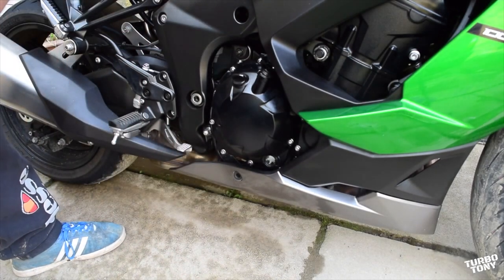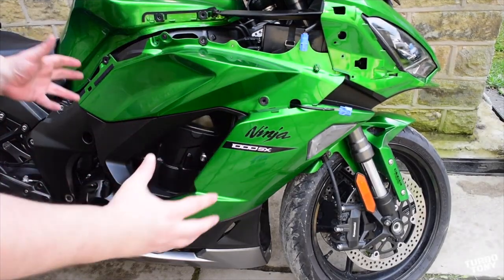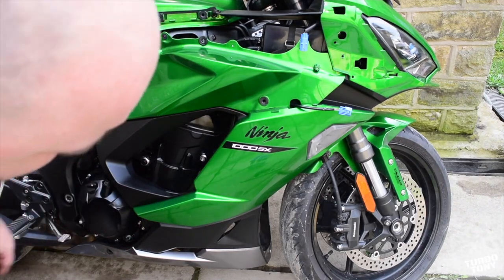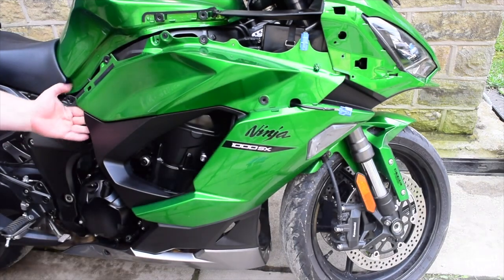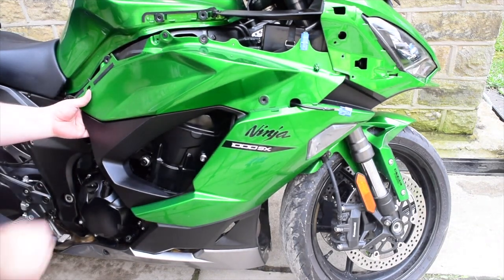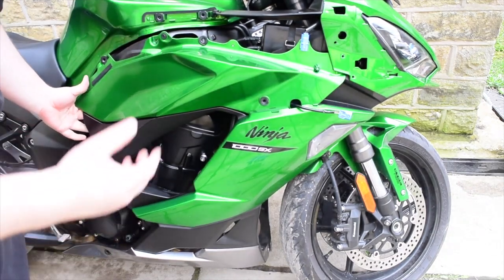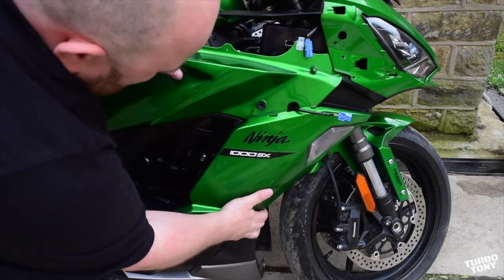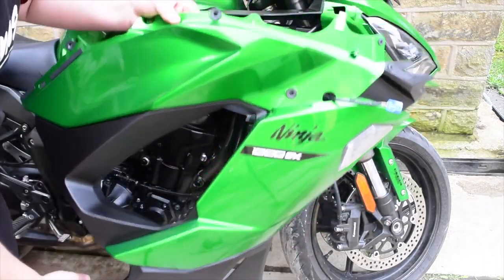The uninstall and install on both sides is exactly the same. Right, we're taking the main fairing off the bike now. We've undone all the bits — this should just slide out. Stick your hands just behind this bit here, there are some rubber grommets that should just pull out, and there's a hook there too — just pull it off like that, not too much force. And this front bit should just slide backwards — yes, that's all the plastics off.